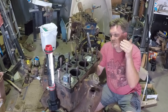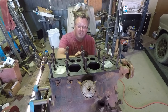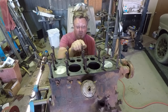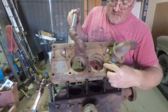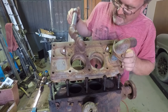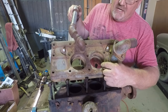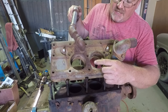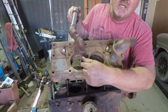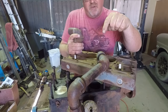That is a gouge, and that is a wrist pin coming out and going into the side of the piston wall. You probably noticed that this motor is missing the valves in the middle cylinders. A lot of people would think that it was because it had been started to be disassembled — that's not why. The reason it's missing those valves is this was an air compressor. This is a cylinder head — these giant gaping holes are not normal in a Jeep cylinder head. This was made by General Supply Company, Kansas City, Missouri.